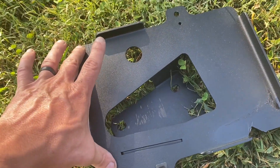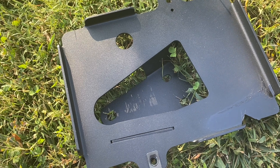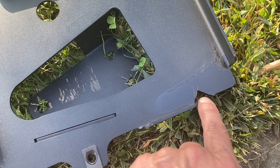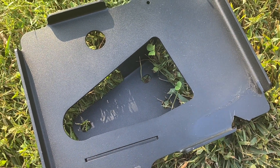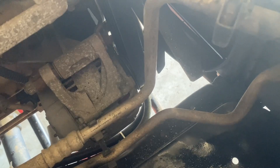This tray does fit in there and it is a little bit wider, so it will accommodate an OEM battery or one of your deep cell lithium batteries — Optima, Extreme, etc. However, on my XJ I had a coolant line rubbing on the side of the tray on the radiator side. So what I did was take an angle grinder and notch that little piece out — it doesn't compromise any of the integrity and won't hinder anything. Your XJ may not have that line. This coolant line right here — the end of the box was rubbing on it. It clears the other one fine, but because it's wider it rubs right here. That's where I notched it — simple fix, piece of cake.